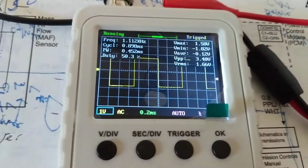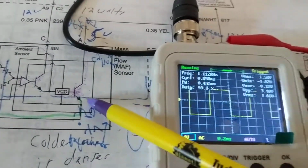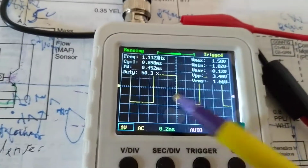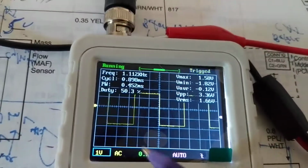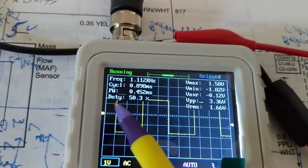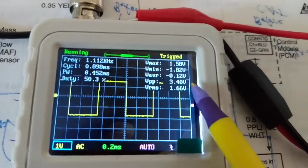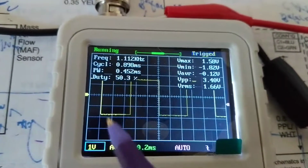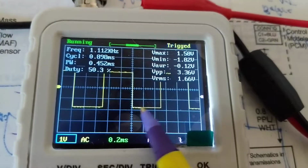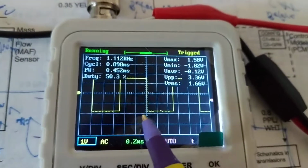How much can you simplify a scope signal? And you have to use a signal scope. If somebody tells me they use a multimeter to measure this, you know what? They're totally off. You cannot see a signal with it. You have to look at a signal. What do I mean by a signal? I mean a voltage that's varying with time. DC voltage is a voltage that's even, level at all times. 5 volts, it's always 5 volts with time. This is not. It's dropping to a lower voltage. It's changing voltage here, here, and here with respect to time. This is time.